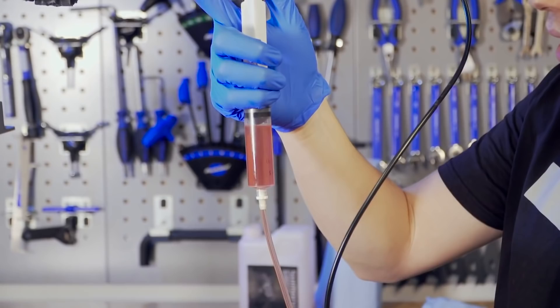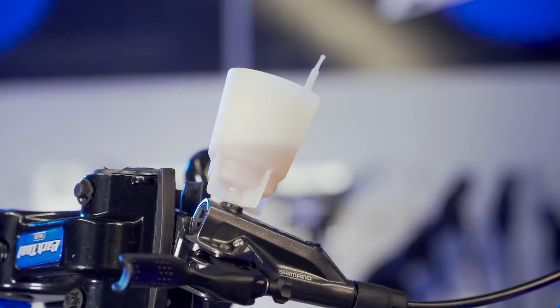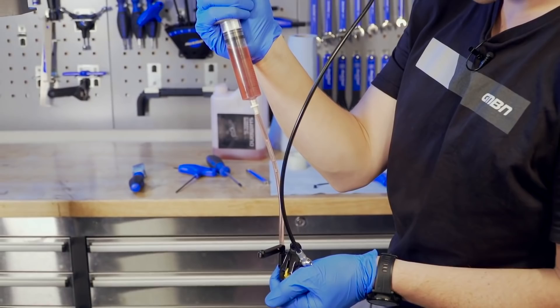A good little hack, especially for the back brake, is to have your bike up on the back wheel — so sitting upright — have your lever horizontal, and have the bleed screw open at the top. If there's any air in the system, it's going to find its way to the top. We're talking an overnight job here. Do not touch that lever without putting it back on and checking the bleed. You'll lose fluid if you do, and obviously risk fluid going near your back brake.